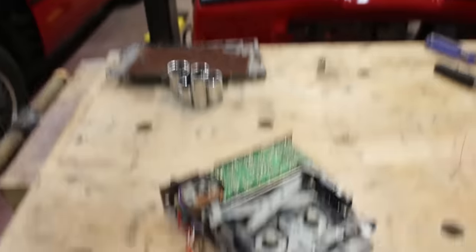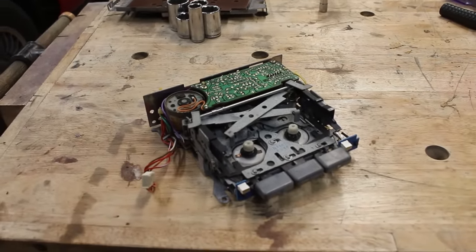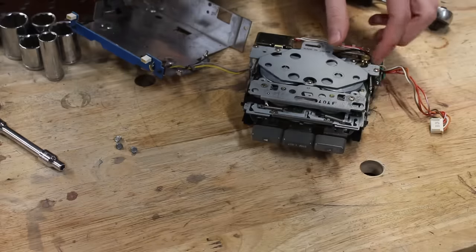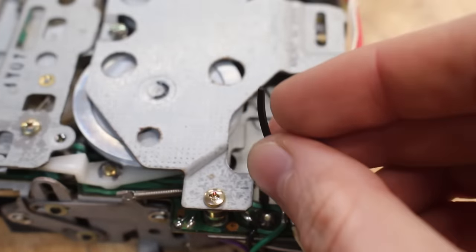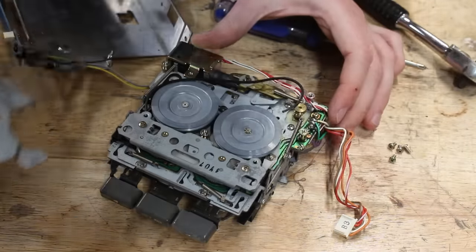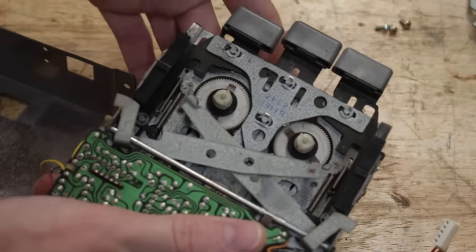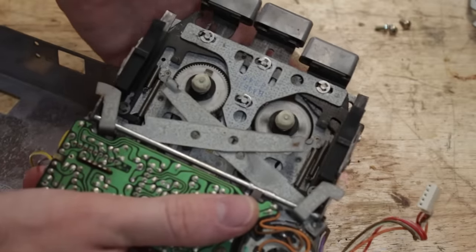Here we go! 99% of the time, if a tape deck isn't working, it's because the little rubber band — the square-cut belt that drives the pulleys that spin the tape — is broken. And my case is no exception. Oh yeah, this belt is all loose! Besides that obvious issue, everything else seems to check out. The mechanisms all move, a tape can be popped in and ejected like it's supposed to, the fast-forward gearing engages as it should, as well as the reverse gears. So I'm hoping that it just needs a new belt.